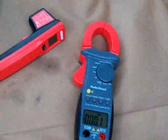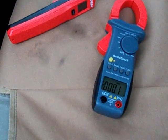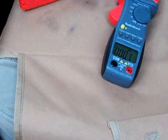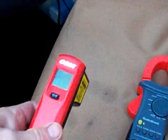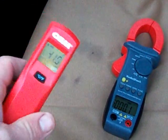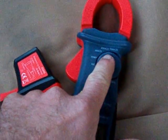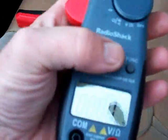I have two tools here that I'm using to monitor the performance of my new Green Fuel H2O HHO system, the GFX-1. It's a 19-plate V6 system. This is an infrared thermometer — you just point and shoot, it tells you the temperature. And this one is a clamp-on amp meter; I have it set at the 400-amp range. Seems to work good there. It has a zero function.